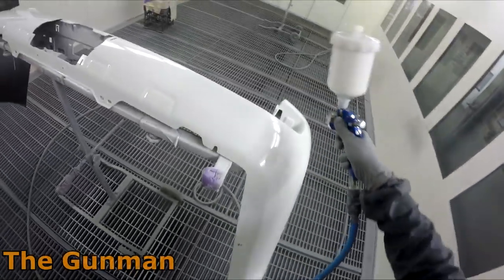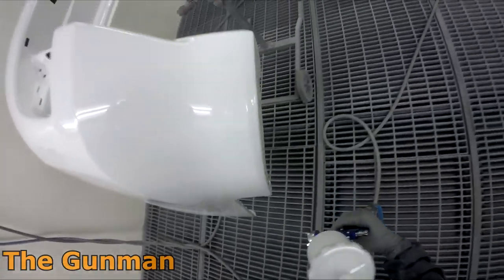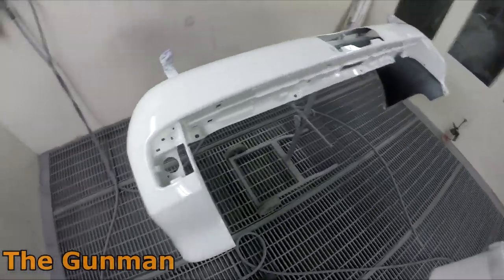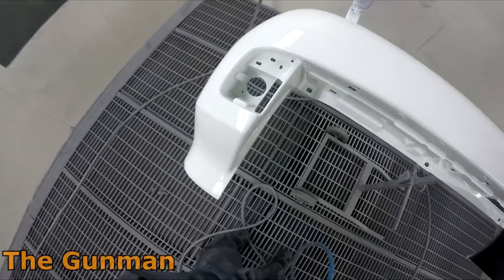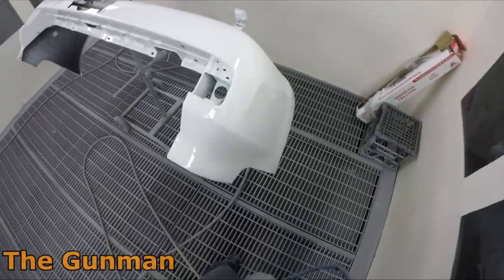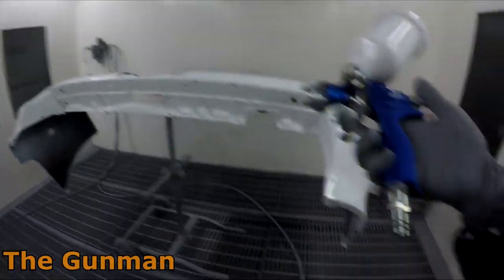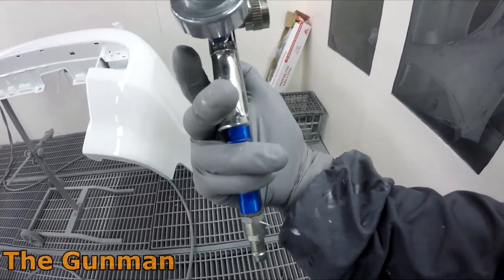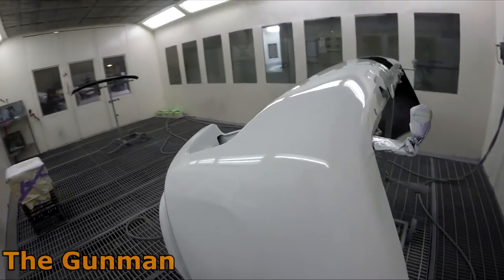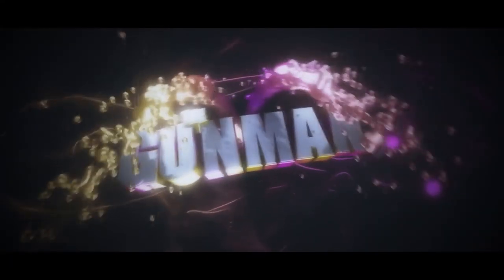I've also used this gun for base coat — same thing, very capable, but for whatever reason I'm just not overly excited about it. As far as settings go, they stay pretty much the same as most spray guns these days: full fan, full fluid, two bar pressure and off you go. Obviously just drop that pressure down a little bit if you're spraying base coat. Hope you guys enjoyed watching — give it a thumbs up, let me know what you think in the comments below. Until next time, get out there and paint some shit.